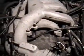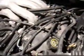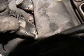And change the spark plugs. It's a basic coil pack design. Just unscrew the bolt, take out the plugs, replace the boots and springs, and then reinstall the ignition coil packs. Squeeze on the tab and pull them off. There's an 8mm socket. Take out the ignition coil, change the spark plugs.